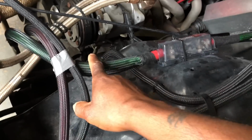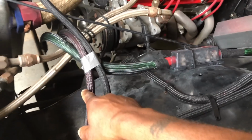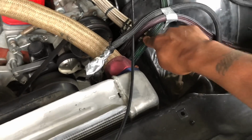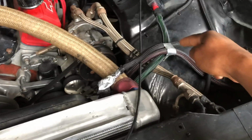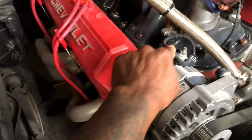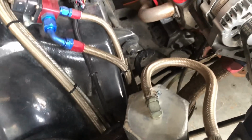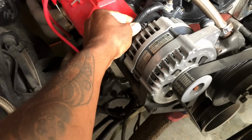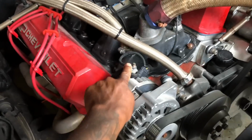Hectic sometimes. So this is the charging system cable. Like I went through all this. Probably when it gets cold, I'm gonna redo it, but not any time soon. So we got the ground straps and all that stuff that I showed y'all. But this green cable charges the battery in the back. Eventually, this is like a 4-gauge charging cable. We're gonna upgrade that to 0, run to the battery, and then, you know what, I ain't gotta do that because this is charging the car. So I just run that 0 here. But like I said, I wanna run 2 runs because I'm running over 3,000 watts.